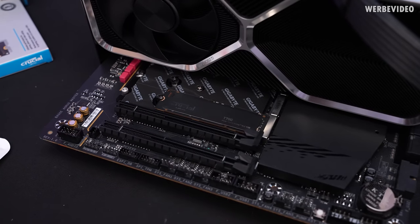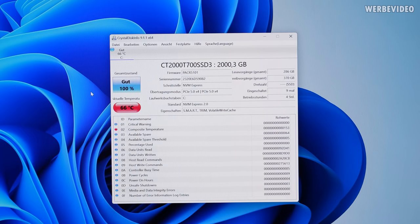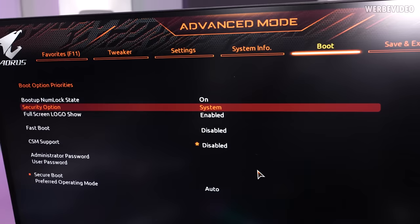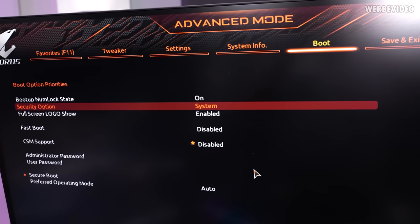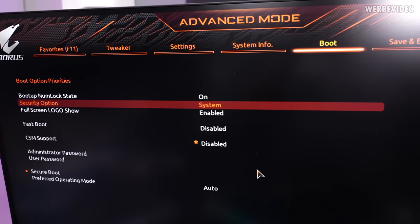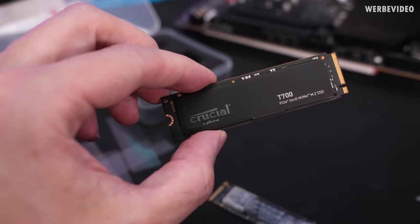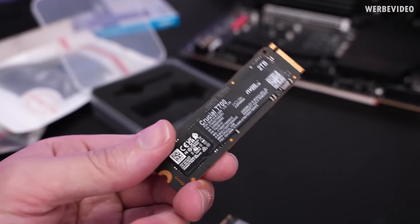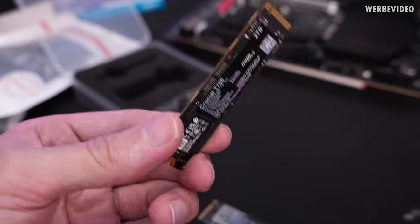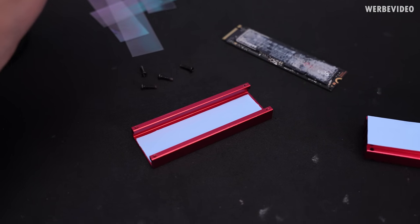Before adding the cooler, the SSD is sitting without any heatsink. Looking at Windows after maybe one or two minutes of idle with no load, it's already at 66 degrees Celsius. After it heats up too much and exceeds the junction temperature, the system just shuts down and reboots, but the SSD is still hot and won't be detected anymore — you have to shut down and wait. That's why running the Crucial T700 without a heatsink is absolutely not recommended, even though they do sell a version without one.